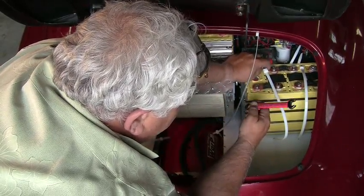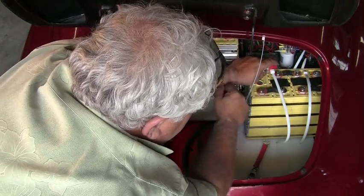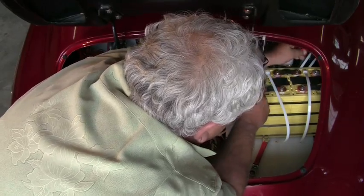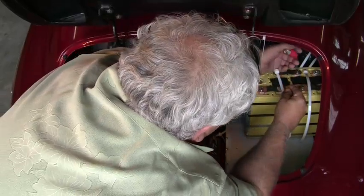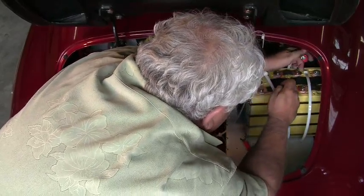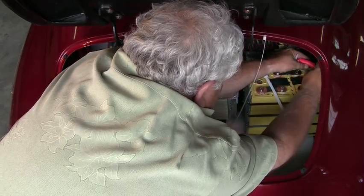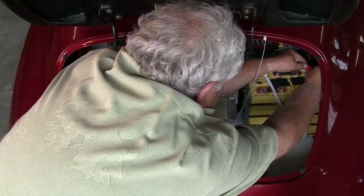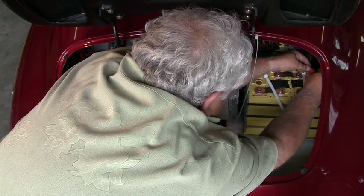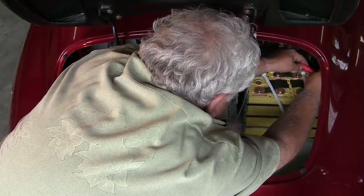Notice I'm not wearing my wristwatch. We actually did this last night — we got one of these terminals on the long battery terminal by accident, dropping it. The problem with these systems is they put out a lot of current and power. You can hard weld that wrench across a couple terminals very easily and burn yourself quite badly. It's not such an electrocution hazard, but it is a burn hazard. You can imagine if you get a wristwatch across a couple terminals, you get your arm back when your hand burns off and falls to the ground.